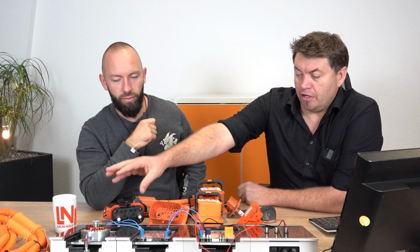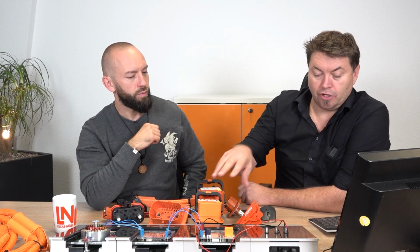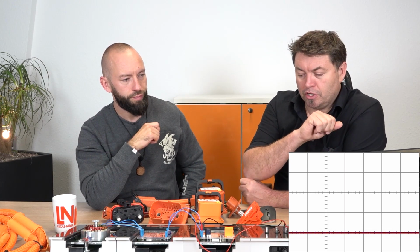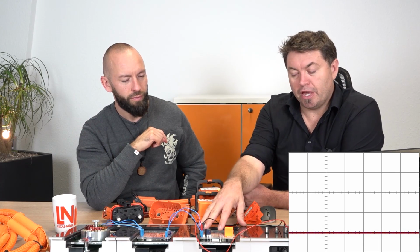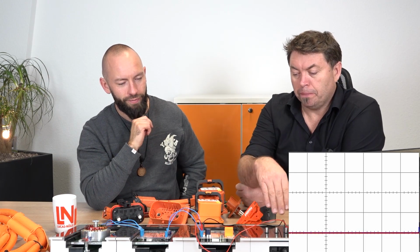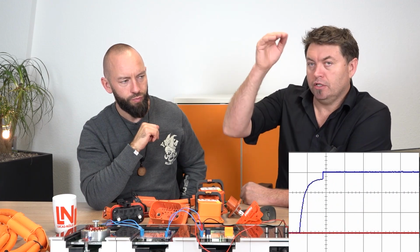The inverter is there, and then the electric motor. What we're going to have a look at today, I've just brought up the oscilloscope in the LabSoft course here as well, and we're going to initialize the system as we would. So start and brake, go into ready mode. You can hear the relays clicking on and off there, and on the screen right now you can see how the voltage builds up to the point where it can drive the electric motor.